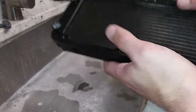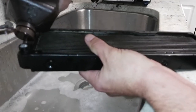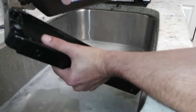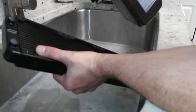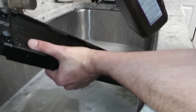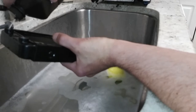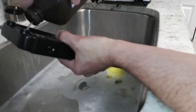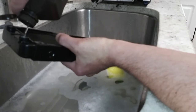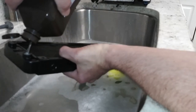No additives — just run straight water and you will not have such a problem. All you really need is peroxide. Take the peroxide, put it straight in there, let some of it work its way to the back, fill up the other side, and just hold it and let it work its way through. Keep filling it, do both sides. I can feel this actually going through the rad right now because it's getting colder as it goes down. Just keep filling it, give it a good little shake to get it down inside there.